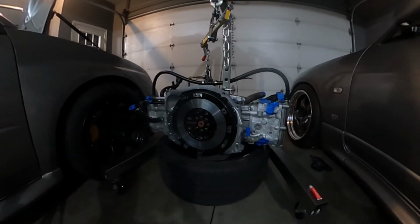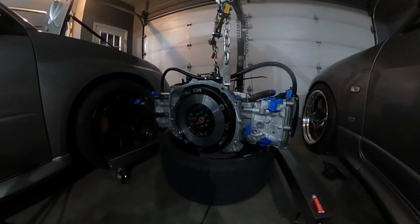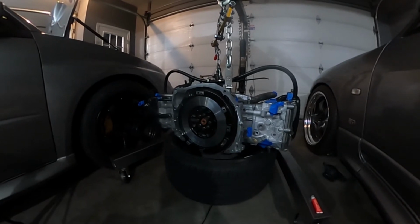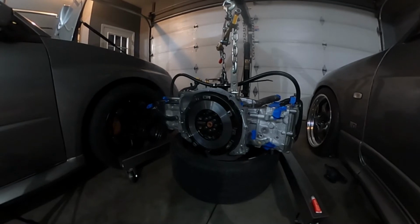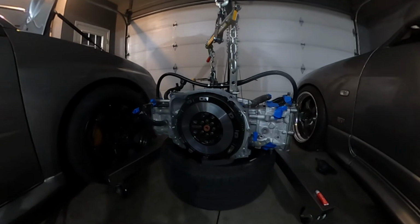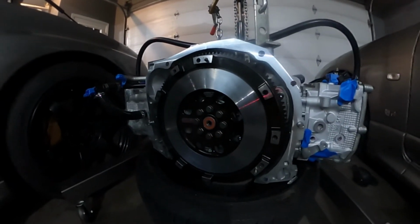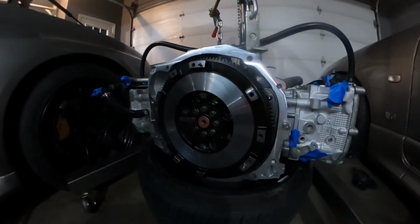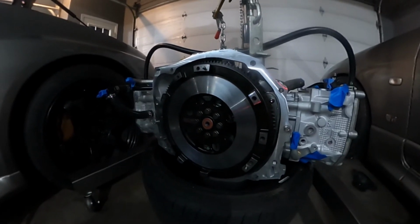Anyway, as you guys can see, the flywheel is installed. In haste, I didn't get an opportunity to film, I just completely forgot. It's really simple. You just gotta make sure that the flywheel lines up with the bolts, and insert a starter bolt on there. What I did was put red Loctite and torqued it to 55.3 foot-pounds, in a crisscross or star pattern.